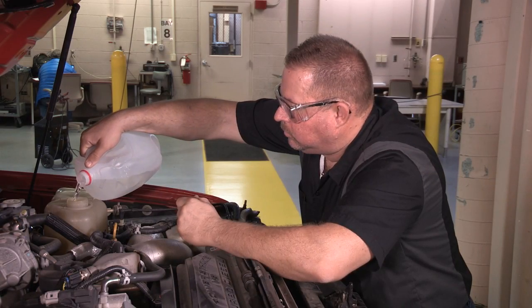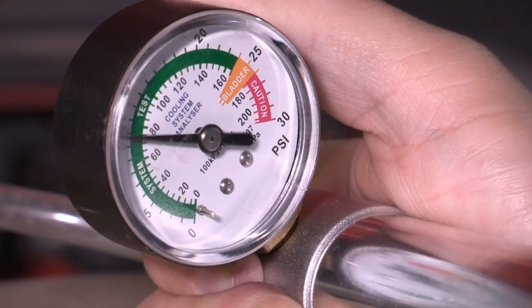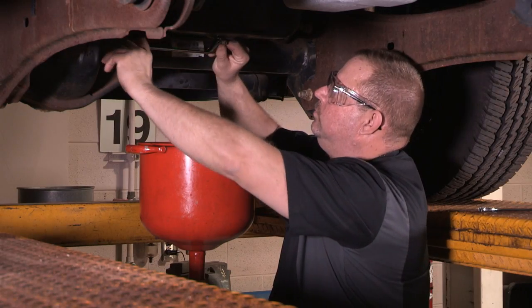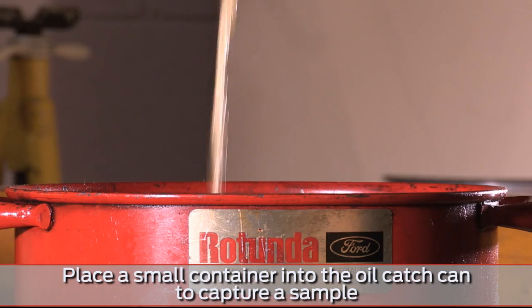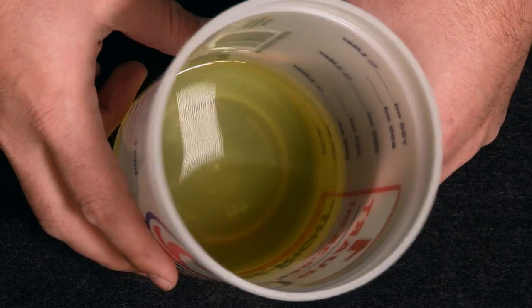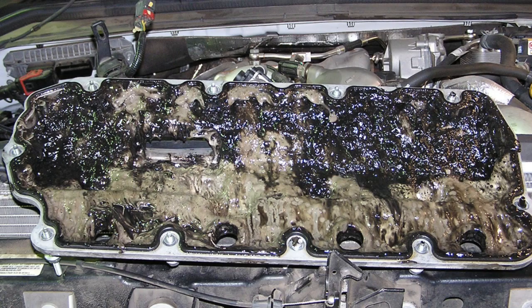If the degas bottle is empty, fill it with water. Then pressurize the cooling system and pull the plug from the oil pan. Usually the coolant will sink to the bottom of the oil pan, so it will rush out first. If any coolant comes out of the drain, it's an indicator of front cover cavitation. If it's mixed, the oil will be a milky gray color.